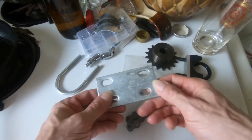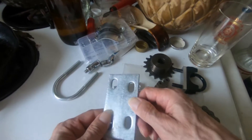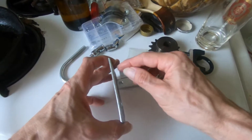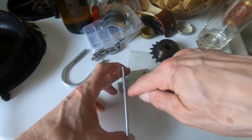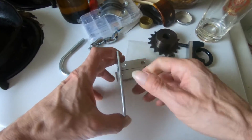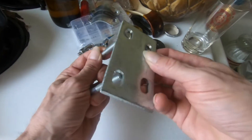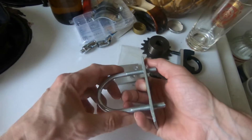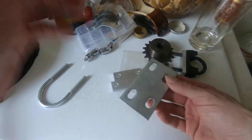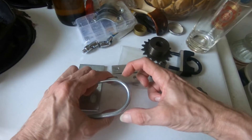What people usually do to fix that problem is get one of these plates. The engine mounts to this with some short studs or cap screws that are short enough that they won't encounter the full diameter of the down tube. Then with the plate attached to the engine, you attach the plate to the down tube with the wider-spaced holes. I couldn't do that — there's not enough clearance. My engine actually sits down around the down tube a little bit.